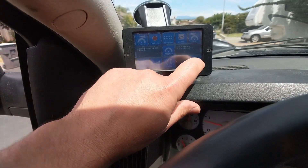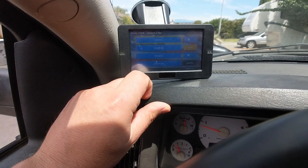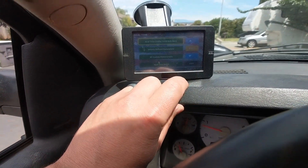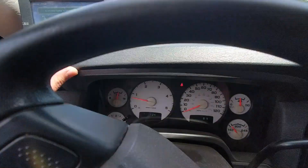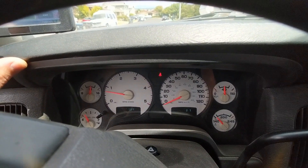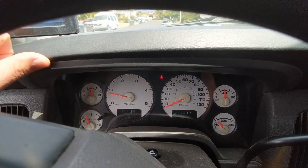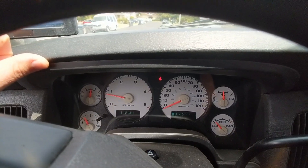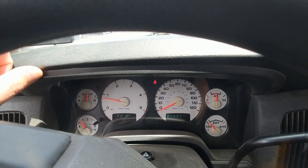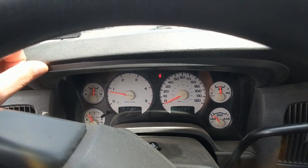Now if you want to go back, you have a couple of options. You can hit RT custom power levels and flash something else over top of it, but I always recommend — to keep things tidy — you hit the real-time reset button. Watch what happens: it goes back up to 800 RPM and the pilot injection cuts out, making the appropriate changes in the ECM to run a single injection event tune.